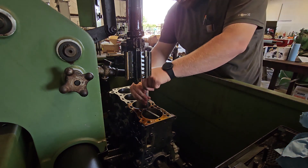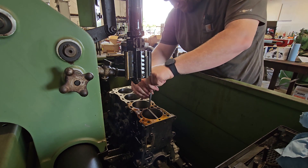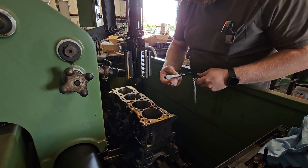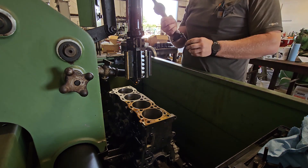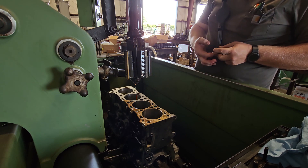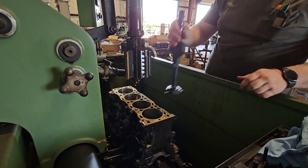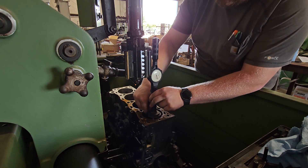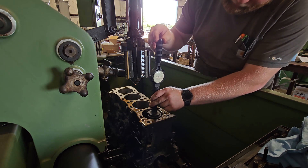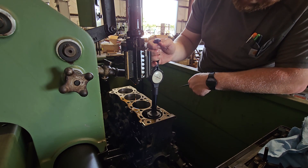In a future video I'll go more in depth. Right now I'm going to measure the bore with a t-gauge just to see where I am in relation to the piston. If I remember right, the bore needed three thousandths clearance for the piston, so I'm measuring that with the t-gauge to see where I'm at. Then I'm going to set my bore gauge — this bore gauge has accuracy to one ten-thousandths of an inch. I'll set it to where I want it, and you'll see how that needle works. It's a quick way of measuring all four bores without having to measure each one with a t-gauge.